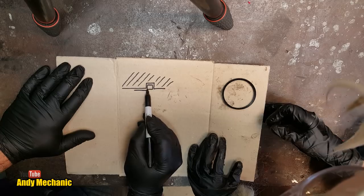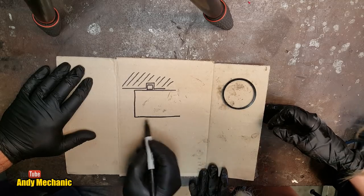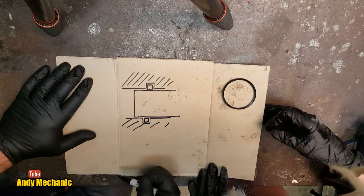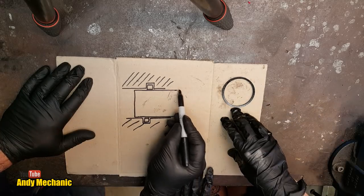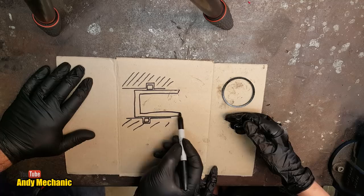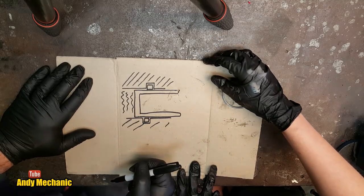Then here we've got the piston. I'm going to draw it with a little tiny gap just for the sake of it. So there is the piston. And of course down here there's the other half of the seal. So we've got the other groove there, and that's all casting. This is the piston in its stationary state. We're not applying the brakes. The piston has just retracted back in, and it's all happy, waiting for the next push of the brakes. And the fluid is all in here. That's what we bled up earlier on.